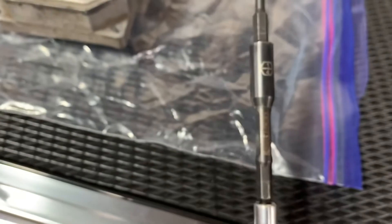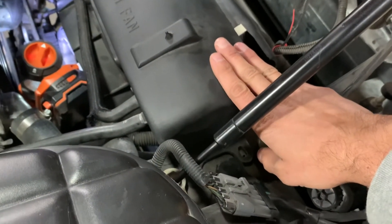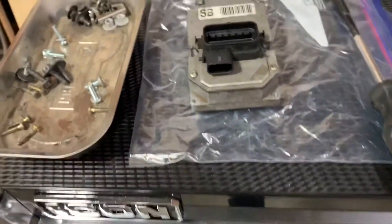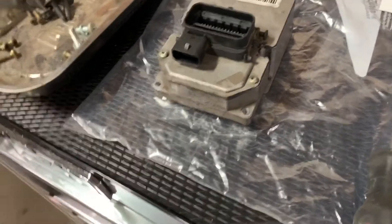The corner ones I was able to use just a screwdriver handle to get to. I had to get a little bit creative with a small ratchet to be able to get into the ones in the center due to some interference. But nothing in the car really needed to come out. I did end up about halfway through the job deciding to loosen up the upper radiator mount so I could push it forward a little bit to get some extra clearance. Reinstallation is going to be just the opposite of pulling it out, which only took me about 15 minutes. No big deal.